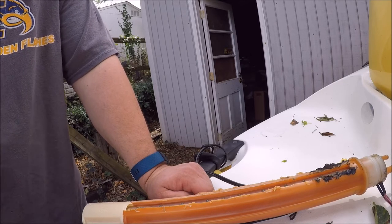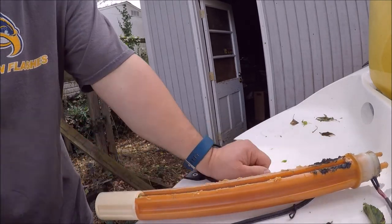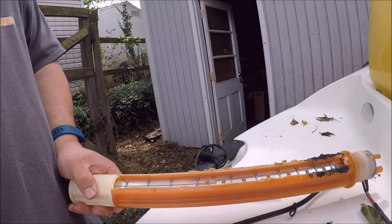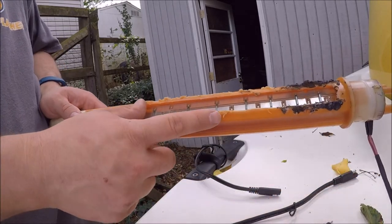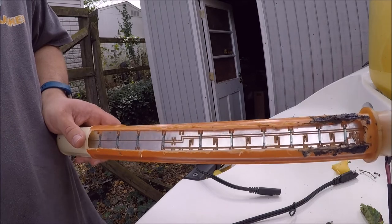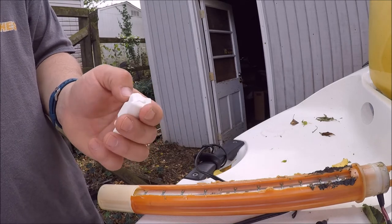The F1 fuse — that was my problem in this case. I would try the other stuff first before you go ahead and actually cut open your baffle, because you might not have to do that. It's kind of a pain, especially putting it back together. Also when you're cutting, make sure you don't cut too deeply and do not cut into the circuit board — if you cut that, you're probably screwed. Wear eye protection, because when I cut this with the Dremel, the goopy plastic stuff gets very hot and I got some splashed in my face. I now have a burn on my face. Always wear eye protection. Check out that F1 fuse and just order yourself a new float — just order it and be done with it. Get yourself a good multimeter and check those things out.